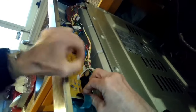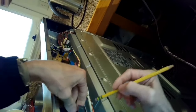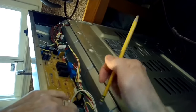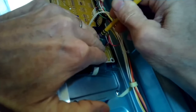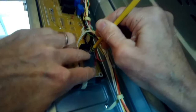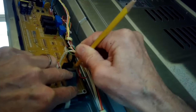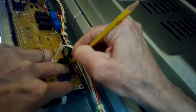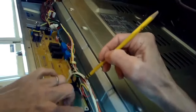We're going to use the eraser to get rid of that film and oxidation. I'm going to pull up on the plastic tab so I can pull the ribbon cable out. Now I'm just going to take my eraser on my pencil and go over this with just a medium amount of force — not very much — to clean off any darkness. I want to get these little terminals or wires nice and bright and shiny, and the eraser does a good job at that.